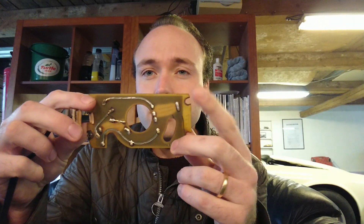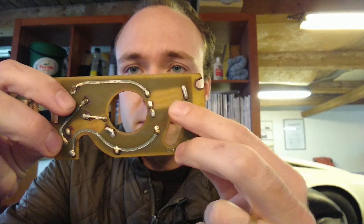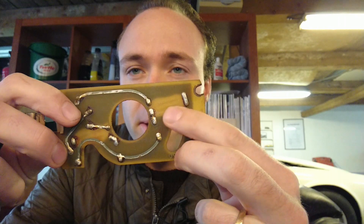This is what it looks like. It sits inside a distributor — this is an original one from the 70s. It has what you call reed switches, one there and one there. You can tell on camera you see that it's a piece of metal around there and a small reed piece of metal in the middle. So the rotor sits here and it spins around, and there's a magnet on the back of the rotor.